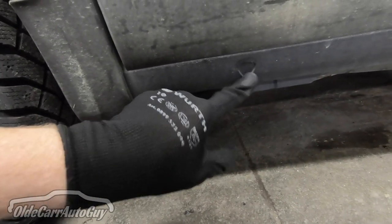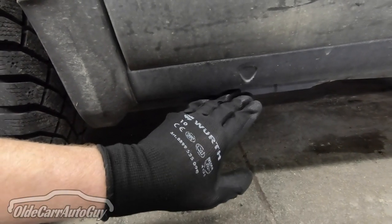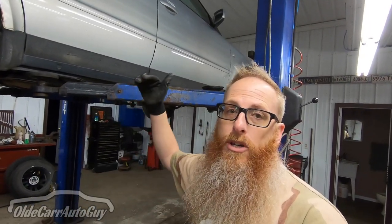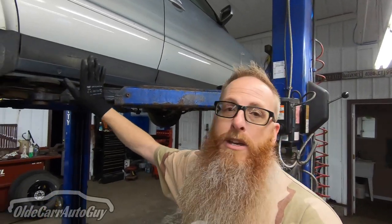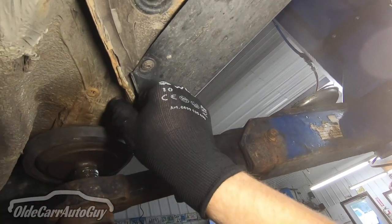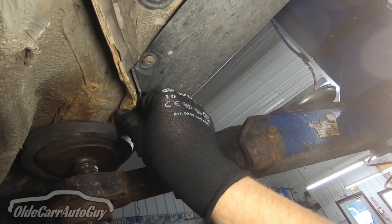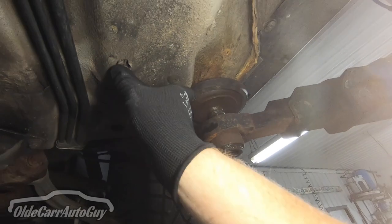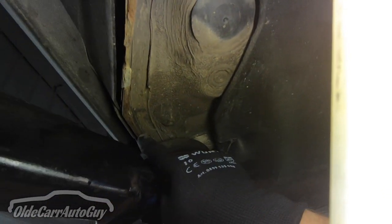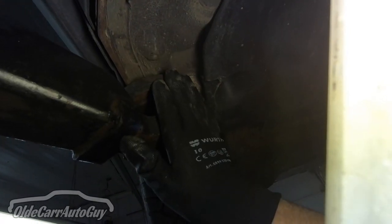On the back side there's a little arrow molded into the plastic which tells you where to put the hoist arm in the rear. The other thing to remember is to always let the hoist arms rest on the safety locks. The reason is that if all the stress is on the cables and a cable breaks, it could jar the car off the arm. So always have it resting on the locks. This seam — where the floor pan and outside panel are pinch-welded together — is where the structural integrity is, front and rear. That's where we want to lift.